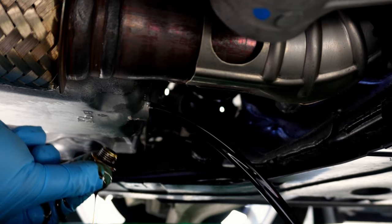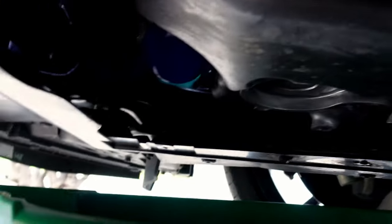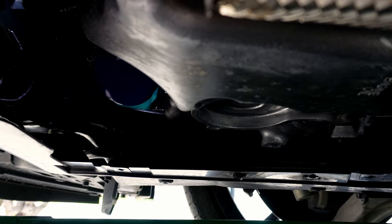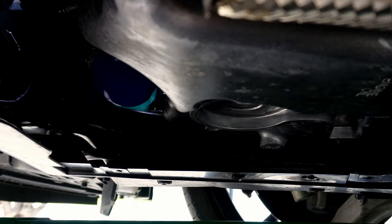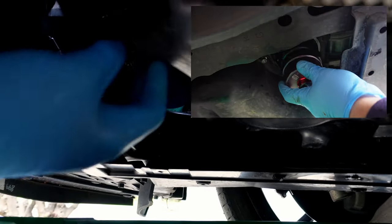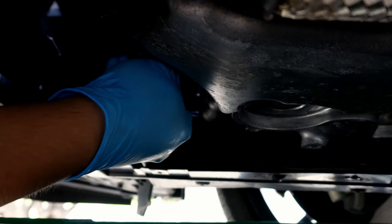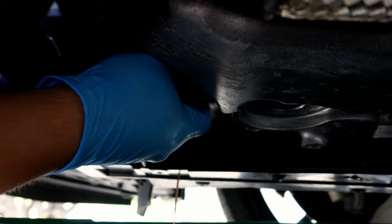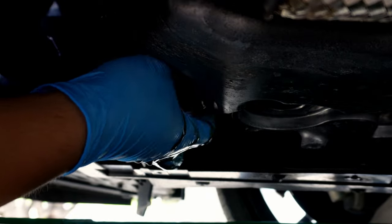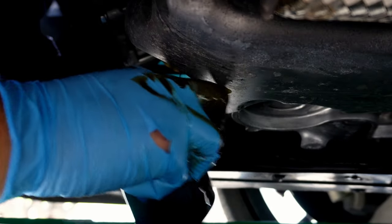While that's draining, we can move on to the spin-on oil filter. The problem with spin-ons is that they are all designed slightly differently. The OEM Honda spin-on requires a 64mm 14-flute end cap wrench, which means the Motivix cap wrench I use with my Toyota guides actually works here. In this case, I got lucky and was able to remove it by hand — props to the last lube tech for putting it on only hand tight. If you do end up needing a cap wrench, I'll have it linked in the description below. Give the car a couple minutes to fully drain and we can go prep the new filter.